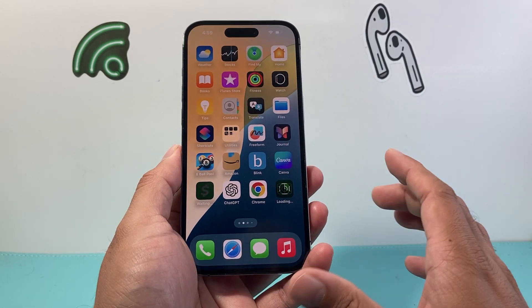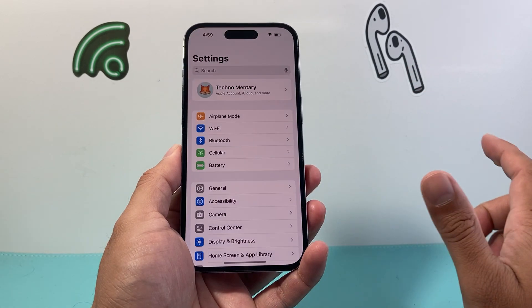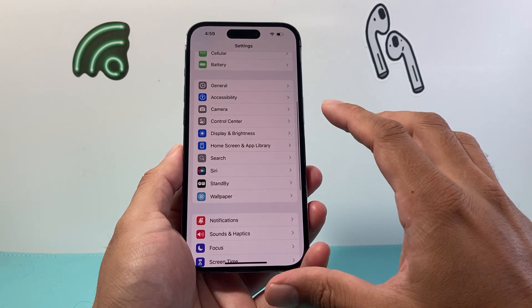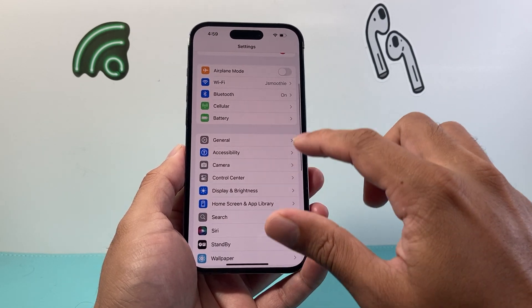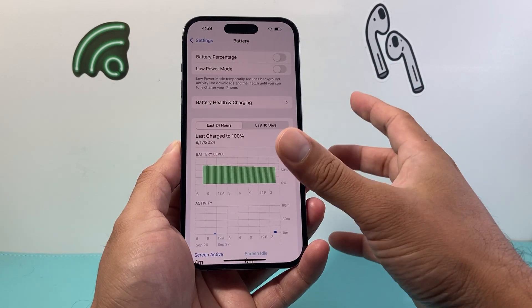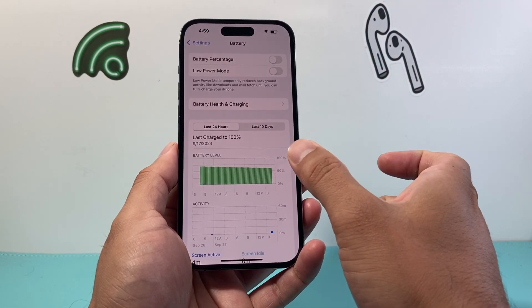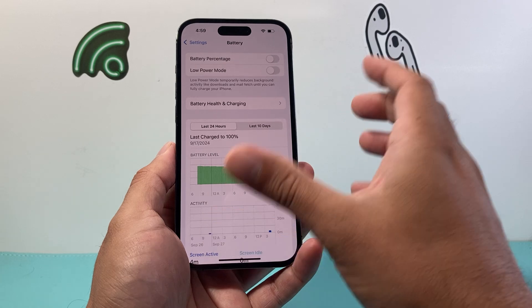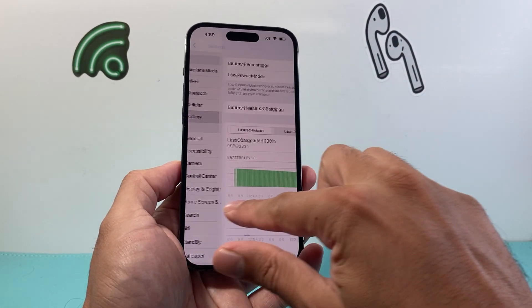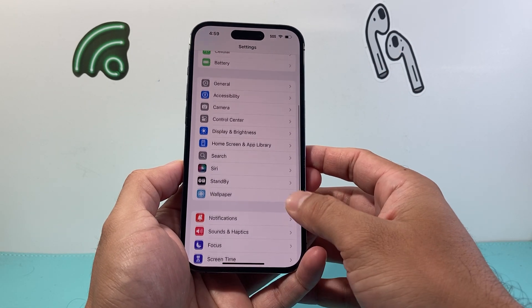Now after you've done that and you're still seeing the overheating issue, go into your Settings and go to Battery, then turn off Low Power Mode. Make sure your phone is charged over 20% — try to keep it between 20 to 80%. Generally when a major update happens, it's good to recharge the phone because it does take up quite a bit of battery, and that's why you might feel the phone is running hot, which is normal as well.